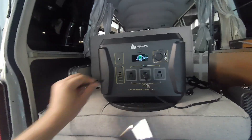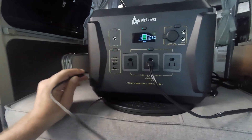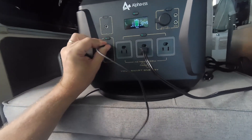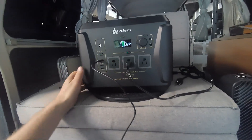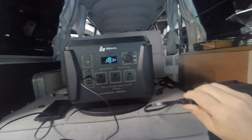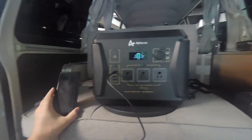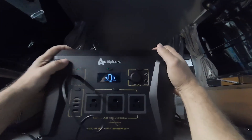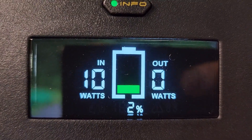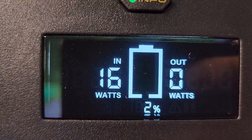Let's test the USB-C ports. Fast charge on the lower 5 volt port, and the 100 watt USB-C is also fast charging — I'm testing this while the 110 volt is working. It's 15 watts on the USB-C. Now let's see how many watts we get out of the 12 volt plug — it balanced out at about 16 watts.